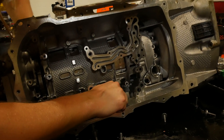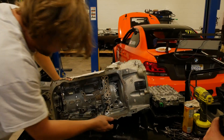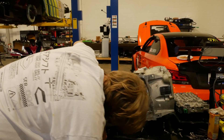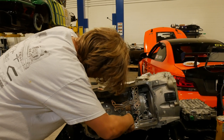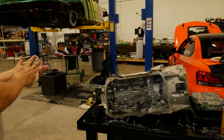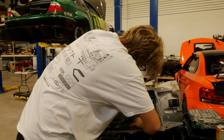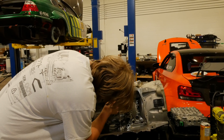Here's the park lock. We're going to do some fiddling with it today because there's currently no solution for it. Factory, once there's hydraulic pressure it opens, but with the engine off it's always in park. The current pull tab is oriented toward the ground. There's a sensor with a magnet to detect park. Literally, the factory solution is a screw on the side of the transmission you thread into the lever to unlock it when the engine's off — like if you're in an emergency situation.